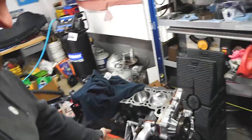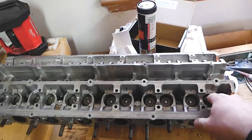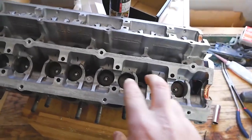What's up everyone, thanks for joining me. Since last time I cleaned up the RTV at the bottom like I said I was gonna do — just razor and peel it all off. Got the head here. I changed the springs. The springs were a pain in the ass. I tried to come out last night to do a couple to get a hang of it, but it took about an hour just to do one. These are a horrible design — they're sunken all the way in and you really can't get anything in there to hold the keepers. Took about three hours total. Tip for anyone wanting to do this: if you have very little patience or big fingers, pay someone to do it.